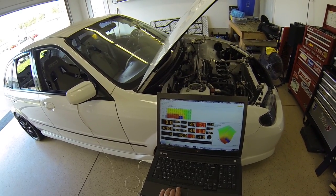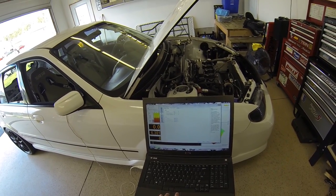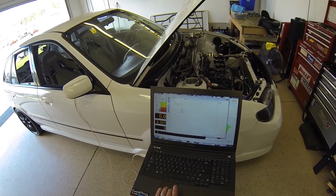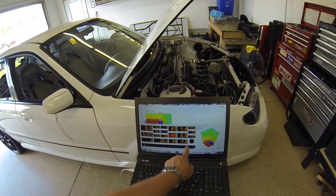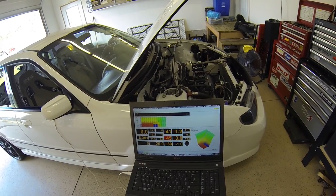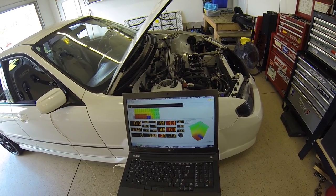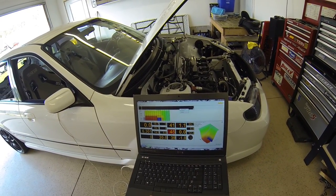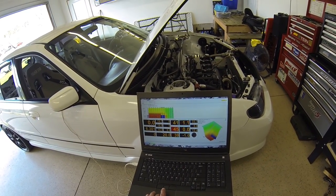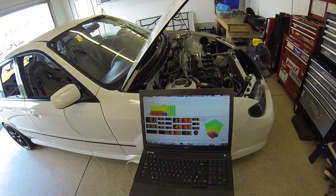The fans are also set on a solid state relay. It's real simple — I'll set this 10 degrees right now which should trigger the fans. The fans are now running at 41.6 percent. If I make this 20... 30, 33 — you can hear them come down a little bit. I rarely see a duty cycle on the fans above 10 percent. There's 23... and off.